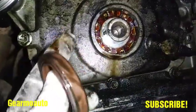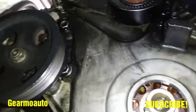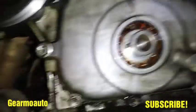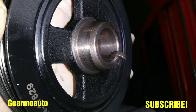Now I'll clean this up and show you why I'm replacing everything — there's a good opportunity to get it nice and clean. Right here is my old pulley. I don't know how, but the crankshaft key slid over and made this huge gouge, and the pulley was bouncing up and down while rotating. So I got a new one for 30 bucks from 1a Auto — usually these are like 100 to 200 bucks.